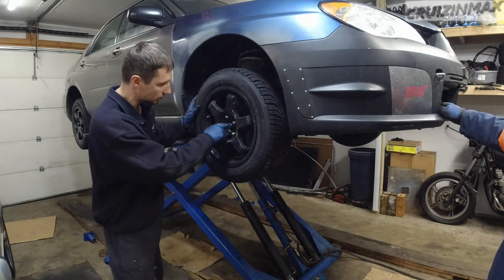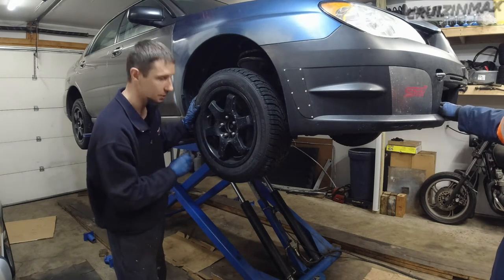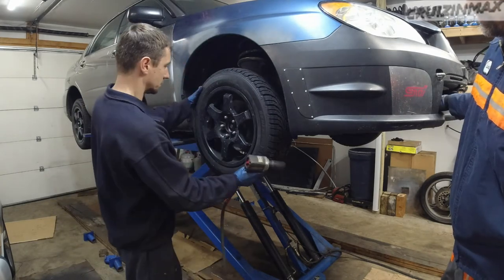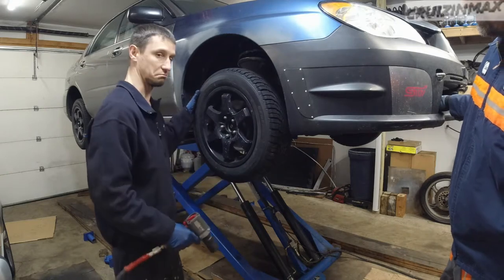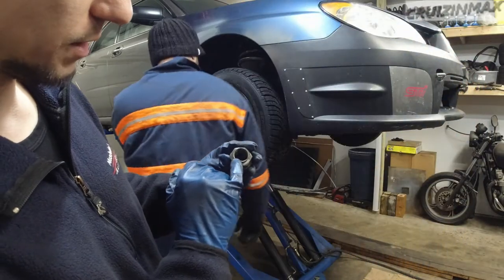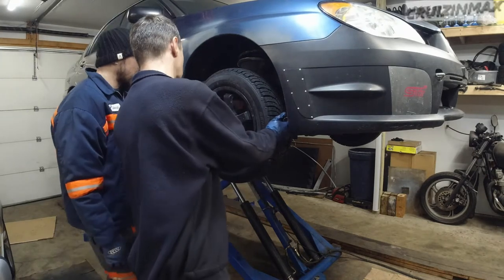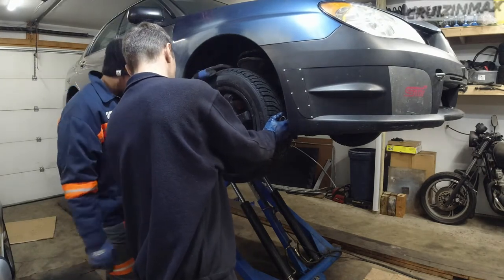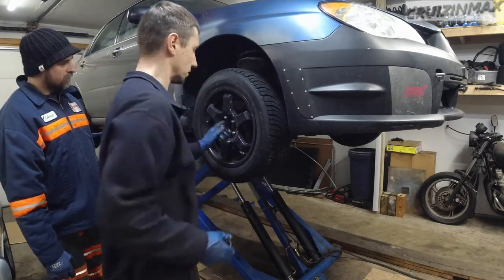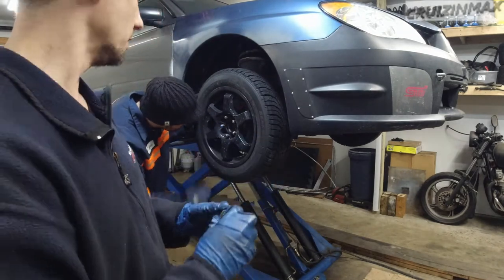But what we noticed, that big bolt, the 32 axle bolt, it undid itself just a tiny bit. I'm gonna see if it's actually loose or not. After tightening it, you do have to knock this in into that. And I think we need to replace the bearing anyway. Yeah, we're gonna replace the bearing. It got loose. Right now we got no play, but I'm pretty sure there's something wrong with that bearing, so we're gonna replace it anyways. But yeah, we did knock this in.